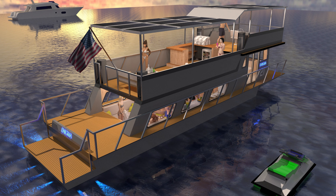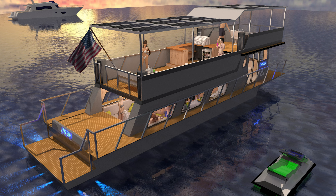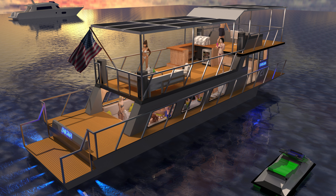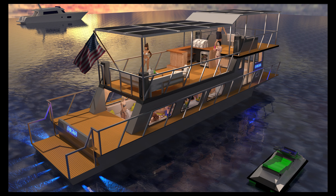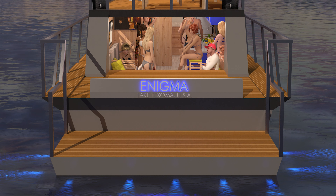Let me show you the first renderings. I've drawn the boat a couple of different ways — with the siding covering the top railings and without. I'm playing with different options. We're going to build a covered awning above the top deck to mount solar panels on, which will give us shade and let us mount maybe 9 to 12 solar panels so we can stop using the generator so much. Gas prices are getting ridiculous — we'd burn a gallon or so an hour out of that generator, so sleeping overnight for a weekend running the air conditioner means burning 20 to 50 gallons just for the generator. Solar panels and a battery bank are a must. At the back of the boat we've got the swim deck — we're going to build a fiberglass one that hangs off the back for extra storage: the anchor, extra fenders, things like that.